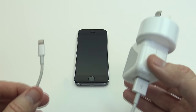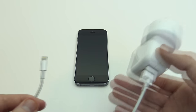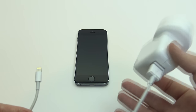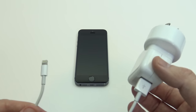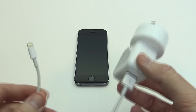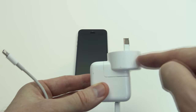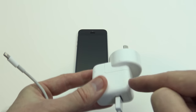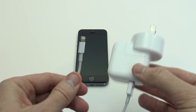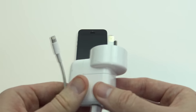Now, the reason why I say this is because if you left your phone and the battery ran right down for some reason, when you go to charge your iOS device it actually needs like 5% before the phone will power on. So just make sure you do at least an hour's charge. The next step I would say is just to try replacing this cable if you suspect it's maybe broken. It could be this part here that's broken, it could be the actual adapter itself, or it could be the cable. So maybe grab another charger from around the house, or make sure that your charger works on another iOS device around the house.